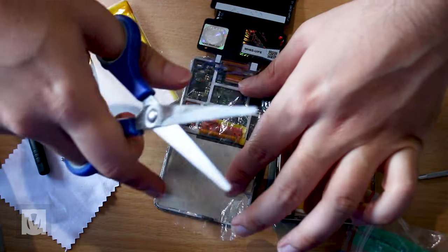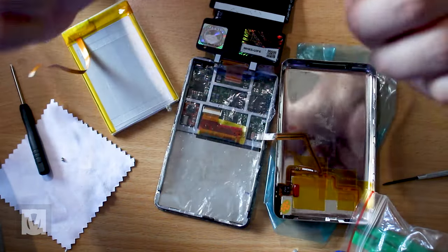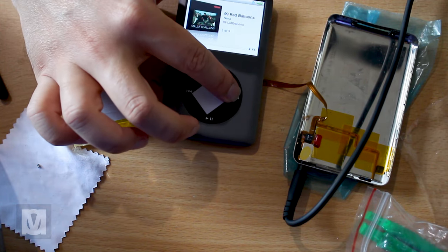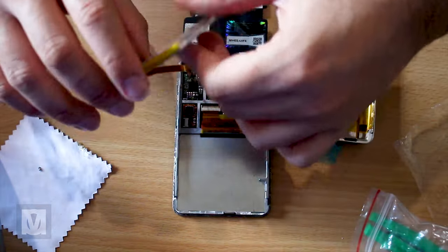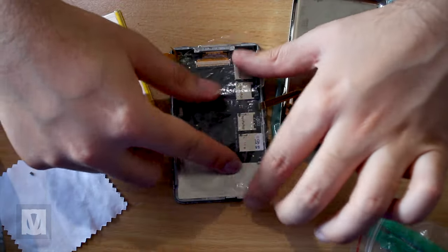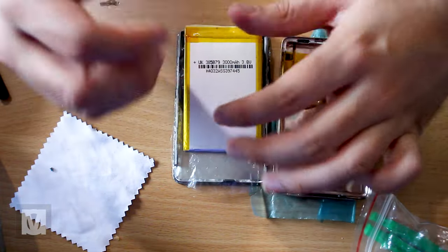I'm cutting a bit of plastic from an old lunch bag to ensure there's no shorting between the chassis and the circuitry. I also did another boot check to ensure it boots up, then formatted the iPod with iTunes and put some music on it to verify it functions. Now it's time to put it all together. Putting in the battery was tricky — making sure the cable was arranged properly and not interfering. It's important to ensure the battery and iFlash stay as close to the dock as possible so they don't go past the notch on the chassis frame.